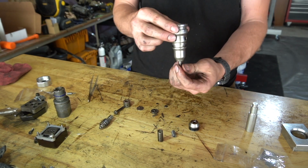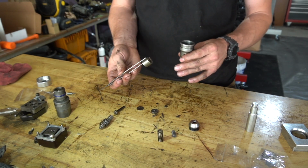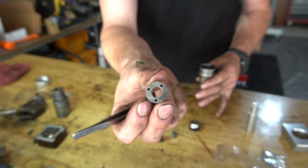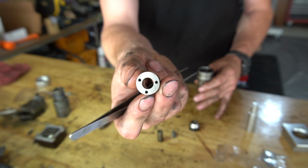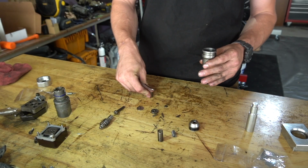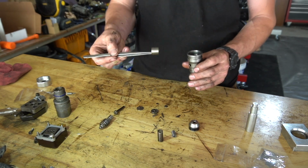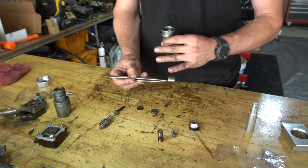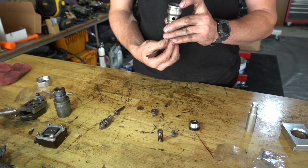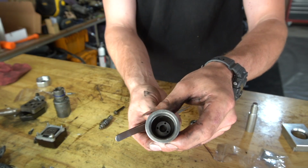During this whole process, you're going to be twisting it a little bit as we drop parts in. Next we've got this big hog here, and notice how all these parts have three holes in them. Those two towards the top of the screen there are slightly offset, so those holes have no choice but to go the correct way. You can grab it like this, and you'll see the parts go in the correct way. Now this part doesn't have an up or a down, and you can just drop it in here. And those pins there, you're going to go ahead and spin the bottom and make sure the top spins.